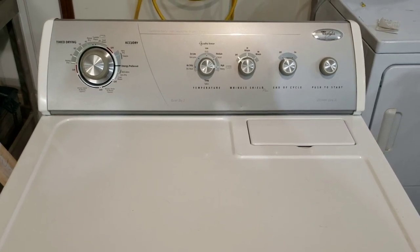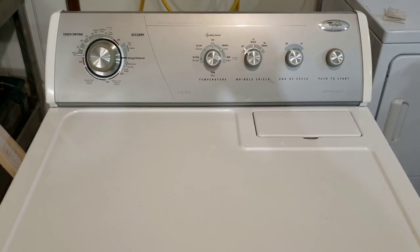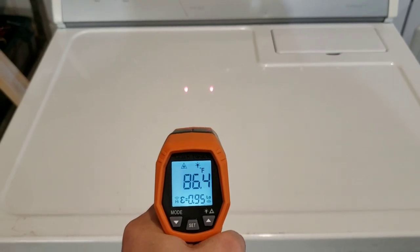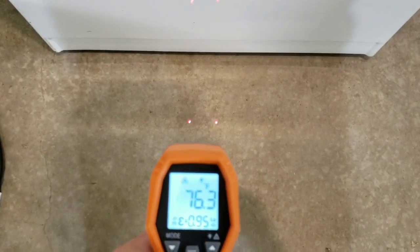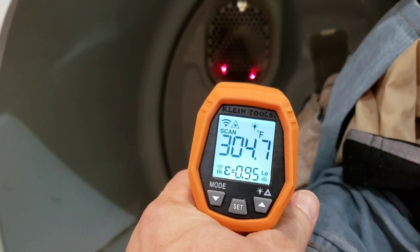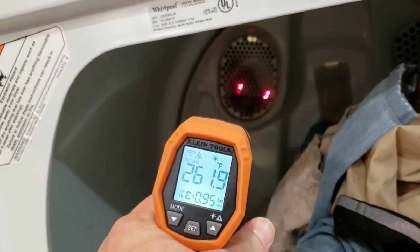As you can see, it's nice smooth operation — sounds great, not jumping all over the place, and there's no weird noises, which are all things you'd check if you were standing here yourself trying it out. I'm gonna show you that it is in fact heating like it's supposed to. I've got my temperature gun right in between those two red dots — that's where you get a surface temperature measurement. We'll open this up and shoot right inside the heating element tube — plenty of heat coming out of there.